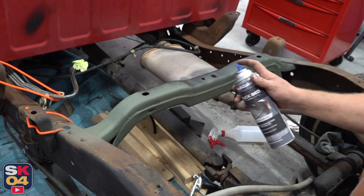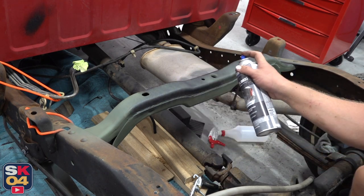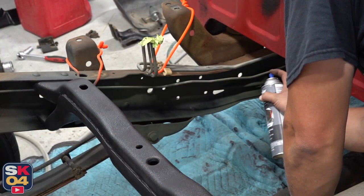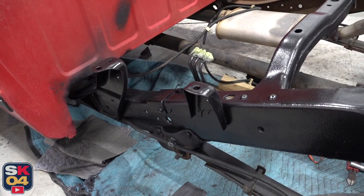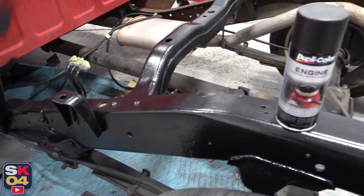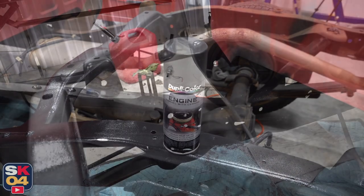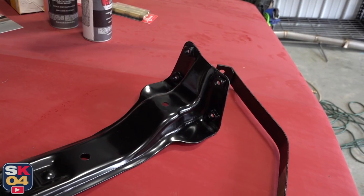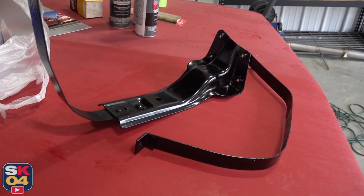There are multiple ways to go about restoring the frame and getting rid of the rust, but because there's not a whole lot of bad stuff going on here, I'm going to sand everything down, get it nice and smooth, and then put a rust inhibitor on it to stop the rust in its tracks. After it's all cured, I'm going to spray on some self-etching primer to make sure the rubberized truck bed liner that I'll be putting on the frame has a good surface to bite into. With everything nice and dry, I'm going to finish it off with engine enamel with ceramic — it's my favorite paint. It's got a satin gloss finish and it just looks really nice.